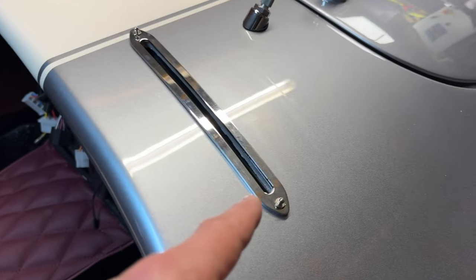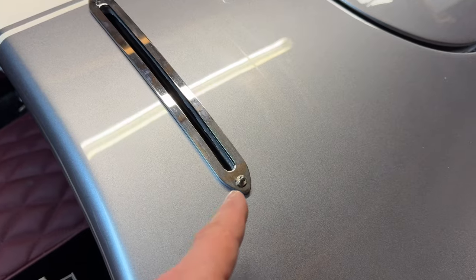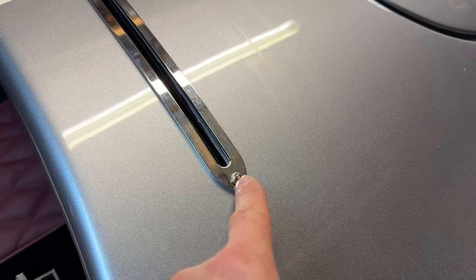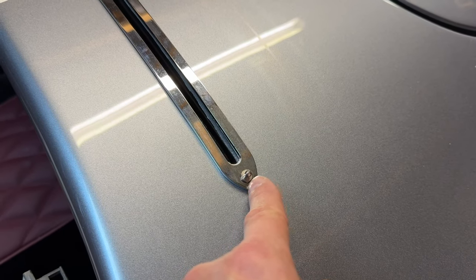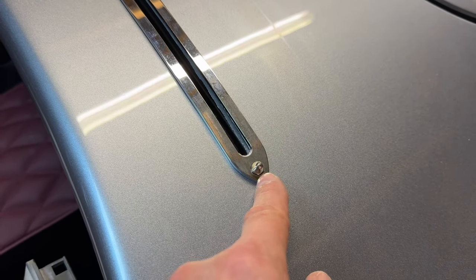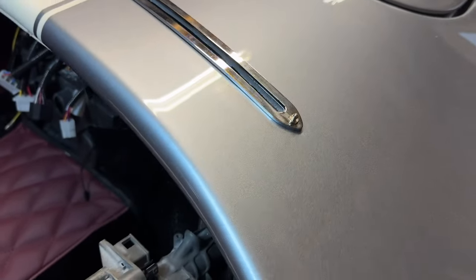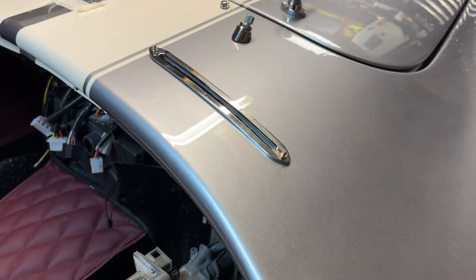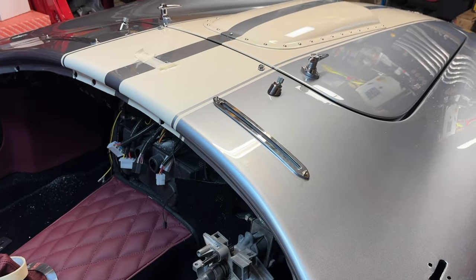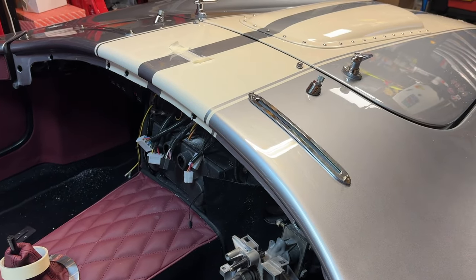Made my holes slightly larger because one bolt was fairly tense and tight, so now it'll drop in nicely. Putting the vents in now. Normally you'd have to put these in at this stage because you can't get a screwdriver working against the rake of the windscreen. However, because the soft top's been fitted we've changed from slotted screws to these - tenax or tenants I think they're called - and you can just hold them with a spanner on top and do up the nut underneath, which is a lot more simple.